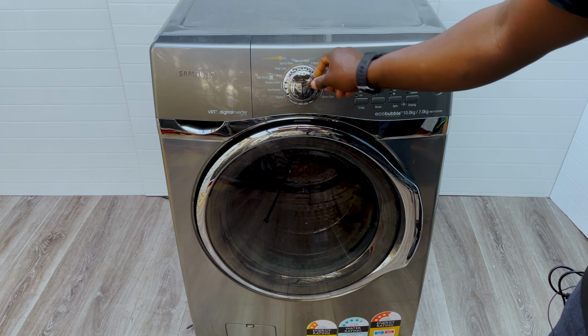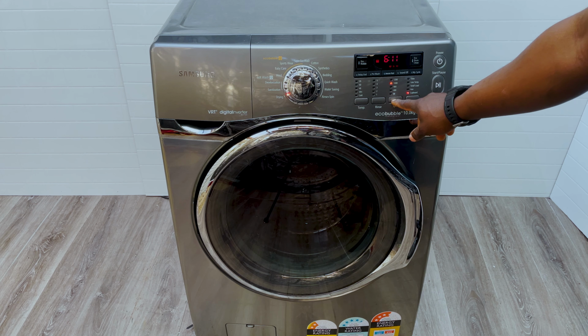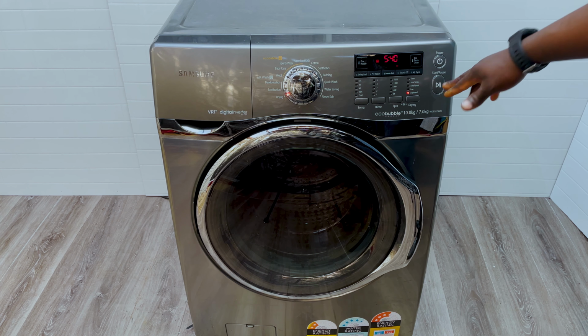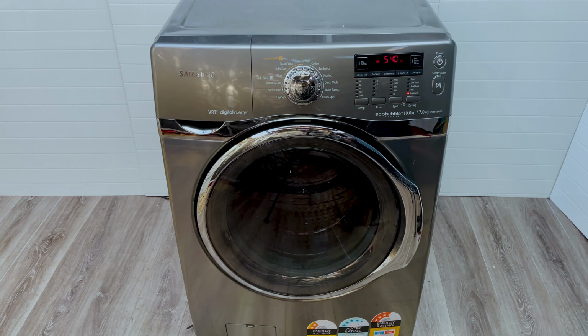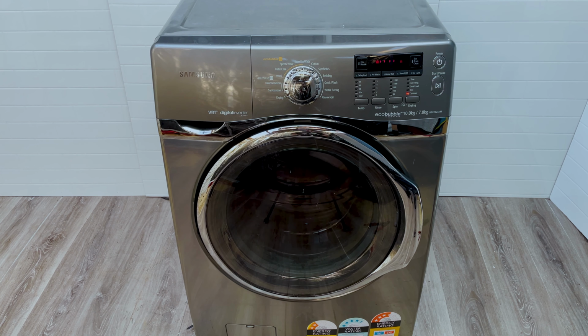And usually if you select the drying cycle and turn off the spin speed, you can immediately get the drying process started on some models, because Samsung spends about 20 minutes spinning the drum, spinning dry the clothes so that you can get a good dry. But if you've already done that, like, we want to test to make sure that the fan's working, so there's no need for us to spin, and there's nothing in there. So we just want to make sure that our fix has worked. Confirm that the fix has worked, which we did before.